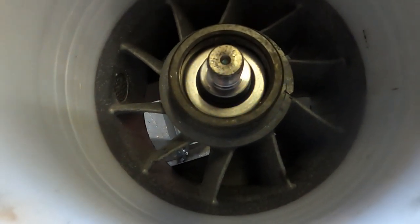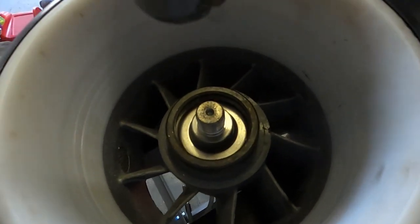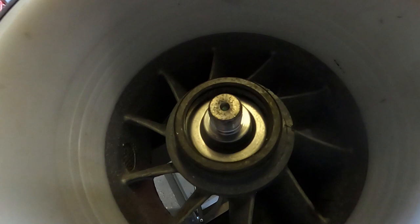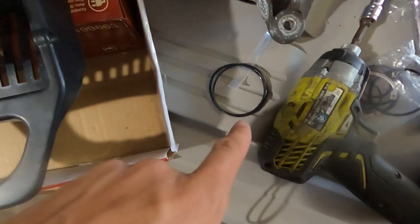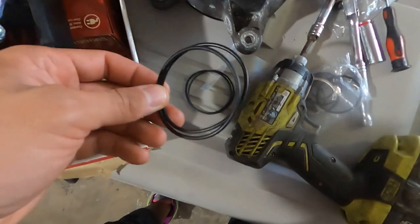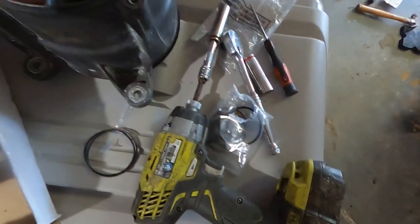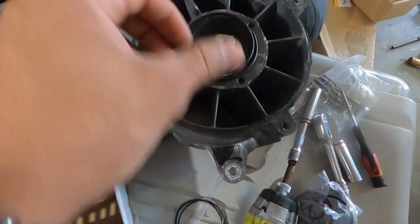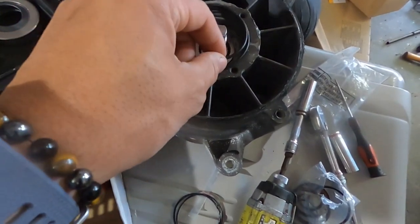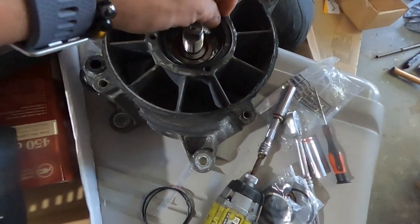Now we're going to want to go to putting in, looks like we've got more O-rings to put in here, more grease to put in here, and those C-clips. So these are my old rings, these are my new ones. I got them in this kit here that has several O-rings in them, and if you're wondering which one you should choose, just set them here on top of the pump. Obviously the one that's larger than the pump is basically where you want to start. The choices I had were smaller than these, so if they're too small, they're just going to fall in too easy.